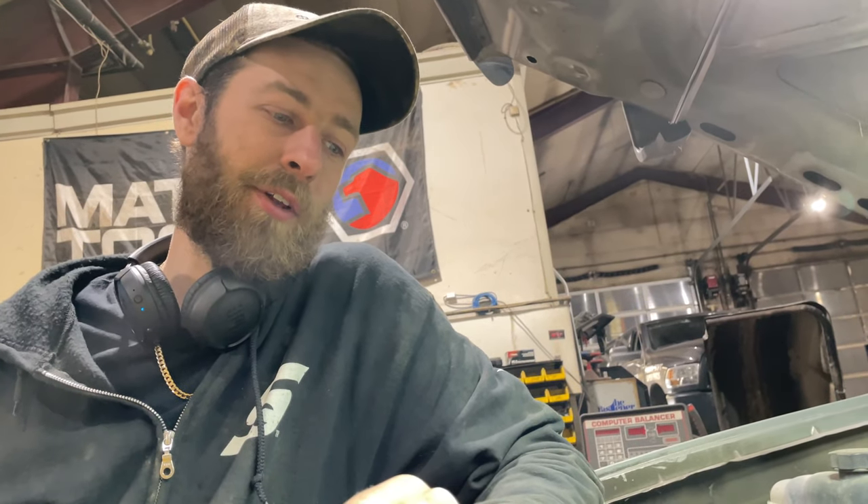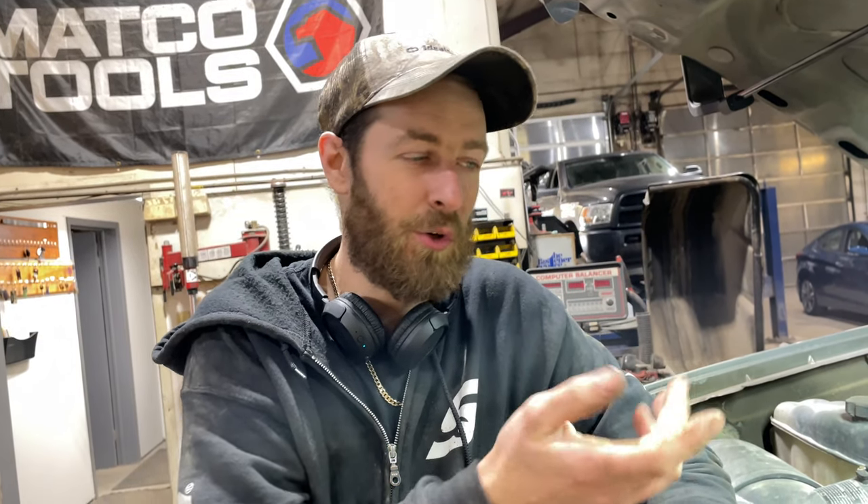Definitely a bit of a wild goose chase — I didn't have a lot of information to go off of on system operation. The technical service info just gives you the basics, like turning the gain up makes the trailer brakes apply more, but no actual measurements or specs. I wanted to share this because I know a lot of people in forums are having the exact same issue — you can stick a test light on the trailer brake output and use the manual lever and the light comes on as it should, but when you use the brake pedal you get nothing.